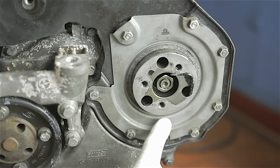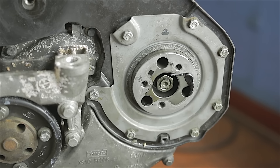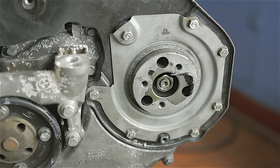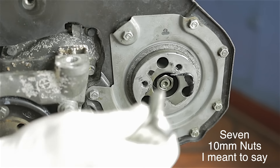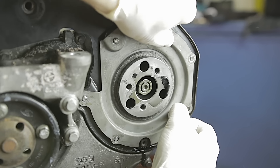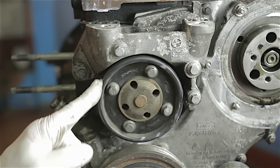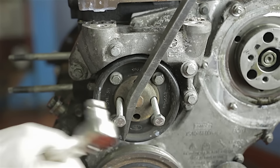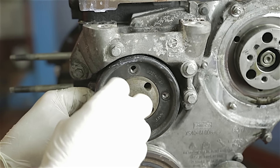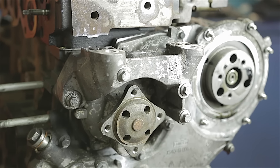This silver plate around your high pressure pump - you buy this as one piece; there's a gasket, a seal, and it all comes with this plate as one whole piece. We have to remove the seven 10mm bolts so I'll get all these taken out. This plate will just come clean off. The back plate needs to come off as well. Now the water pump pulley has got to come off - and that's our water pump pulley out of the way.